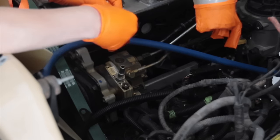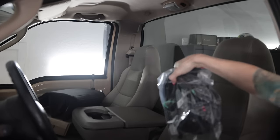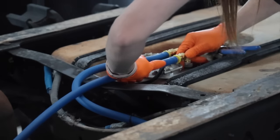There we go. This is the last fitting in the kit, so presumably this fuel line routing in the engine bay is likely going to change. The new fitting's got an O-ring, so this just needs to be loosely installed. The next part — I said I wasn't gonna do any more wiring after taking a break on the RE21 for a video. It's just a harness and there's no point in installing it because the truck isn't even wired to run yet. Literally just a plug-and-play harness. Angel food cake to the rescue — now I got some hose.